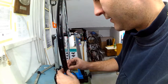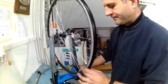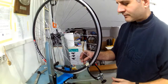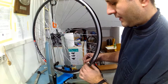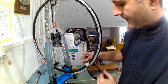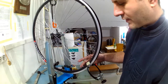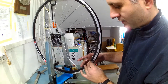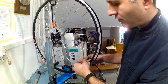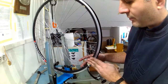I have found one portion of the rim that is slightly out of true, moved a bit to the right, and I will try to compensate by tightening the spokes. In this initial phase when the wheel is being built, most corrections are done by tightening since we want to move towards a highly tensioned finished wheel. In the later stages corrections can also be made by loosening some spokes because we don't want to overdo the tension of each particular spoke. I can correct this by tightening the left hand side spoke near the place where the out-of-true is most pronounced.